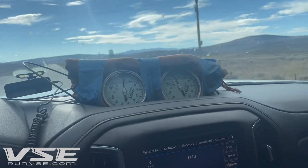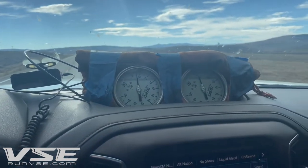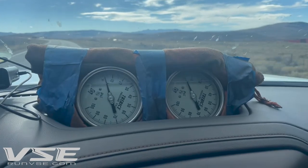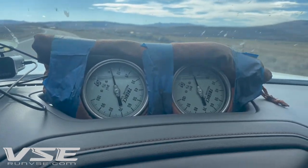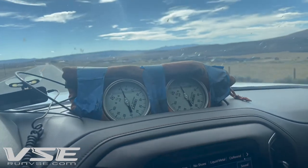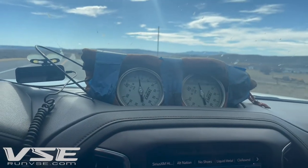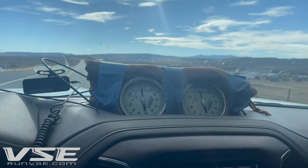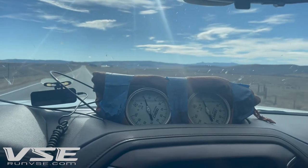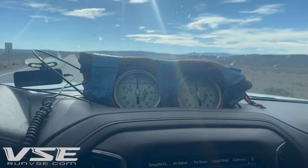That is how we validate turbocharger performance on the compressor side. For overall turbocharger performance, you can see right here on the left we have exhaust pressure and on the right we have boost pressure — both registering in gauge pressure. We use this setup all the time for drag racing and sled pull trucks, which is why it's taped together. A lot of people get excited about drive pressure ratio, which is the relationship of exhaust pressure divided by how many pounds of boost pressure the turbo is generating.